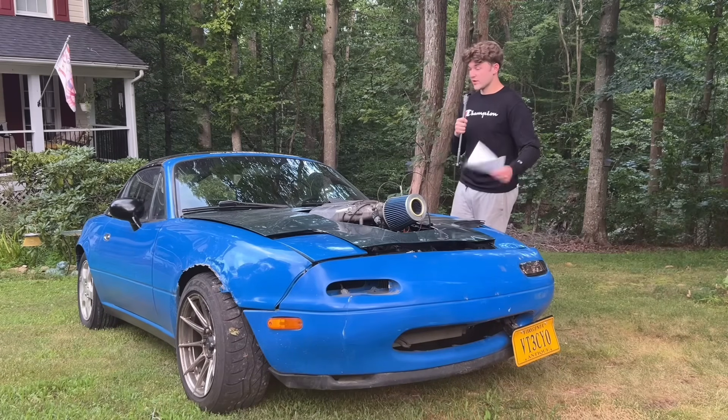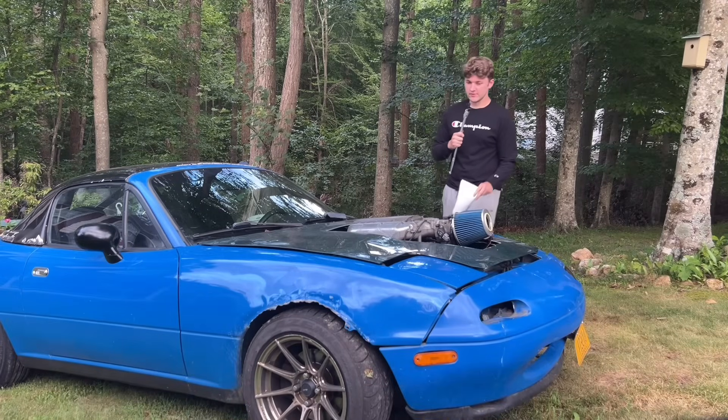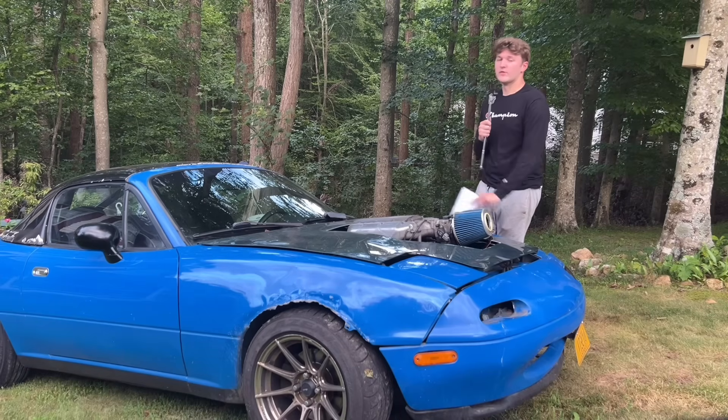You can still use a 1.8 Miata clutch if you want — there's only like a 20-millimeter difference, so you're not really losing much. Then that all comes together using an ACT heavy duty pressure plate. Included in the Oz Engineering kit, there is a copper sleeve that slides over the Miata 5-speed spline, and a modified throwout bearing is then slid over that. When you're all bolted up, bolt the trans right up and you're good to go.